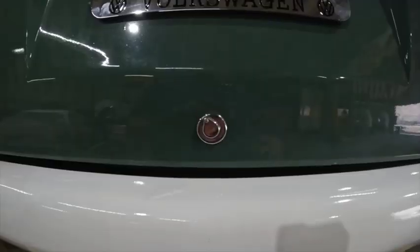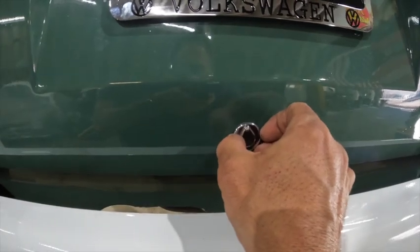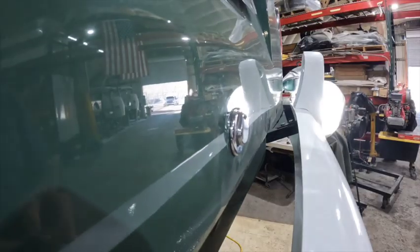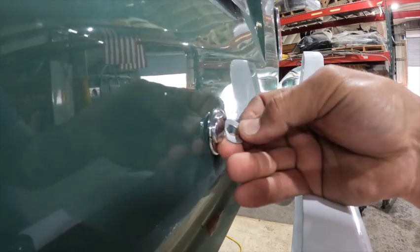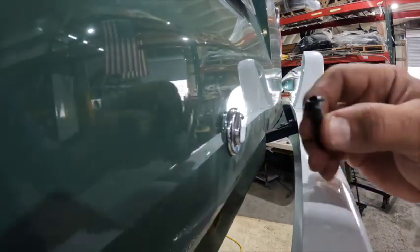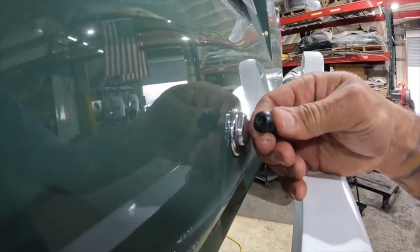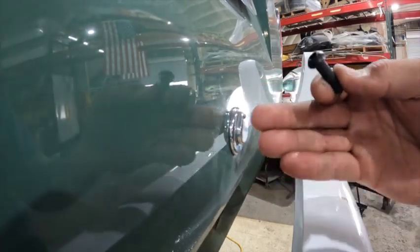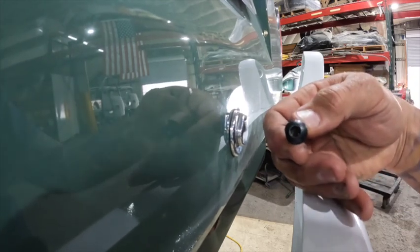That's why that sucker's like that. So when we're going to put it in, we're going to also straighten that up so that it is directly on top — you want that pointing upward. That's why we have this washer relieved as such, because when this thing is open it's going to be holding that open. And that's why I have that bolt relieved as well, because it's going to be resting up against there. This side stays stationary — it's going to be holding that flap up in that direction. We're going to be doing the tightening from the backside on that 10 millimeter nut.